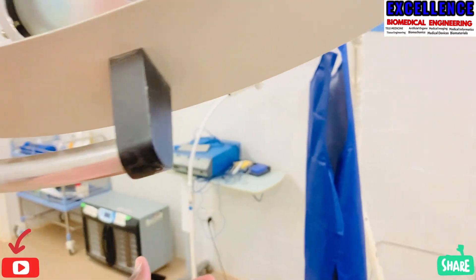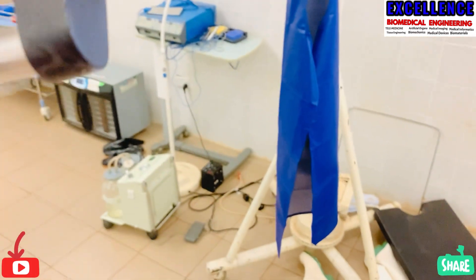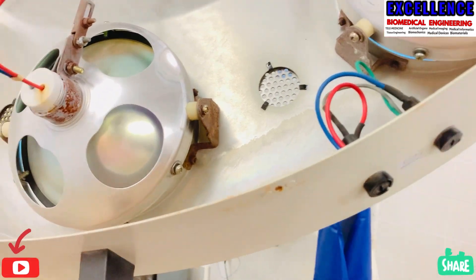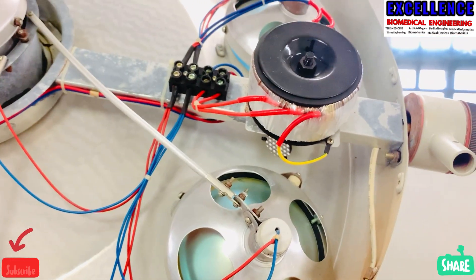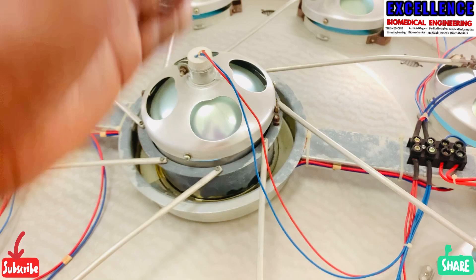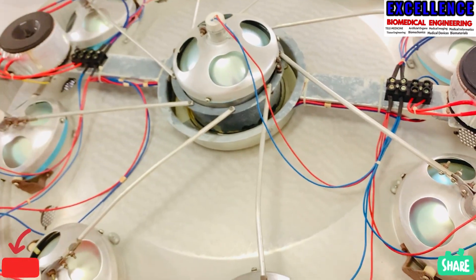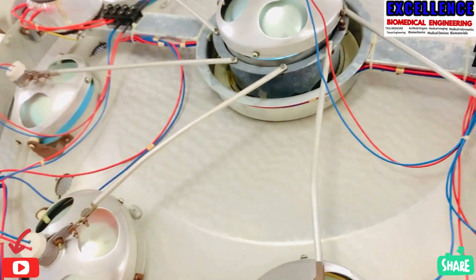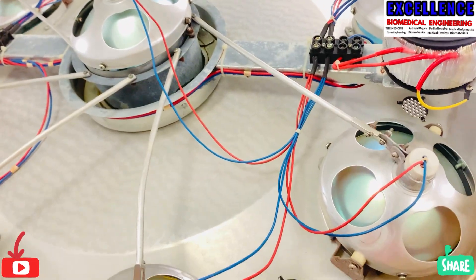First of all, when you start from your power cord — if it is all right — you come to the fuse. And then you go on: we have high power inductors over here, which are two mounted, because it is separated into two. Part of this is for one inductor, part of this is for another inductor. So you check the inductors, see if they are functioning very well.